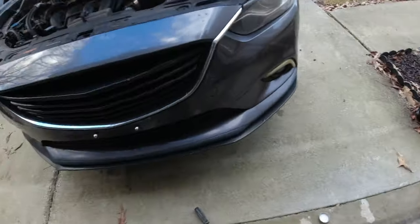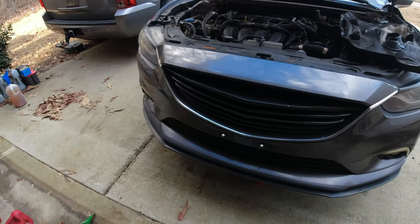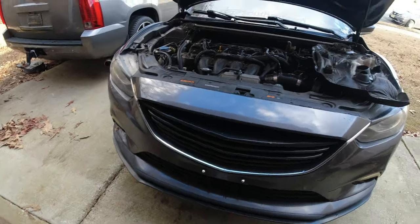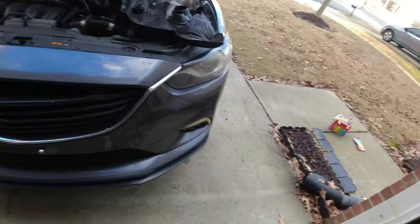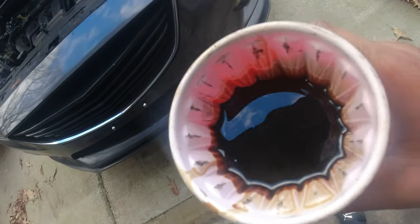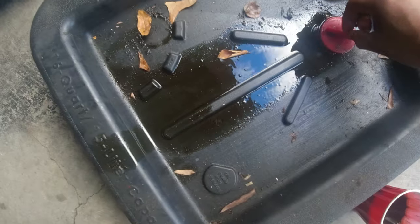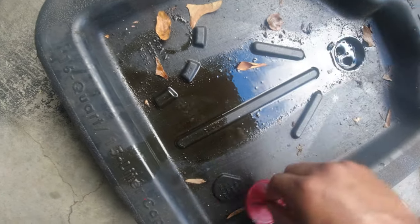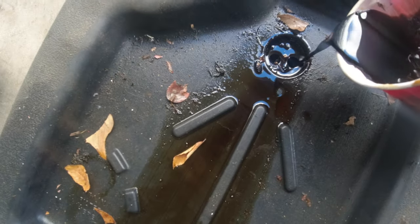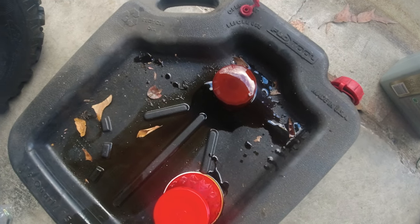Here's what's done. I'm going to back the car off the ramp and then back it up so we can get the rear passenger side wheel off and look at what's going on with the lower shock mount. Here's the oil filter in the cup - all that oil that would have came out is just in this cup. I take it off, pour the oil and the filter out - the filter is going to be upside down - take that, put that there, take my cup to the side, and boom, nice and clean.